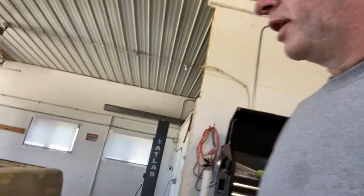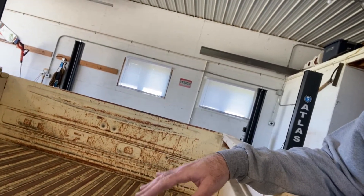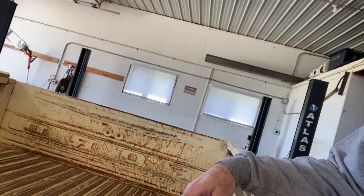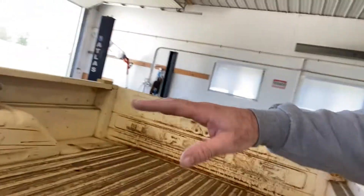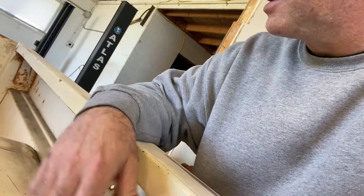And then I'll go over the whole thing with 120 grit. I'm not going to do anything with the inside of the bed because I'm going to Herculiner or Rhino Line it anyway — put in that textured black bed liner. So I'm just going to scuff this up and put that Rhino liner in there. It'll be all up on the sides, everything. That should be pretty nice — it's a nice coating, protects stuff, and it looks nice. It'll just be black.